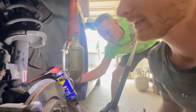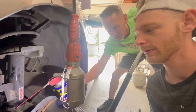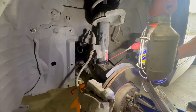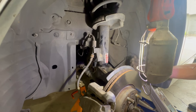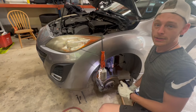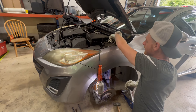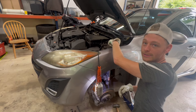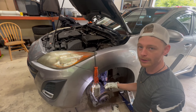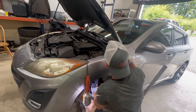On this car, the steering knuckle slides off the bottom of the strut rather than a simple pinch bolt setup — it slides down inside. Before you get started, knock two of the top bolts loose, leaving one on top to hold the whole shock in place. Once you knock that down, it'll be easy to get the strut out. After you knock that down, you can just push up on it and reach up with your hand to get it out.